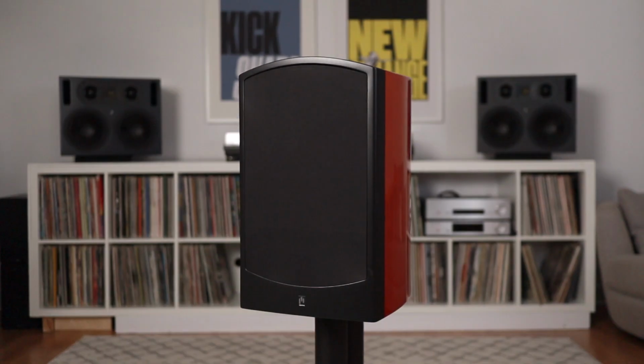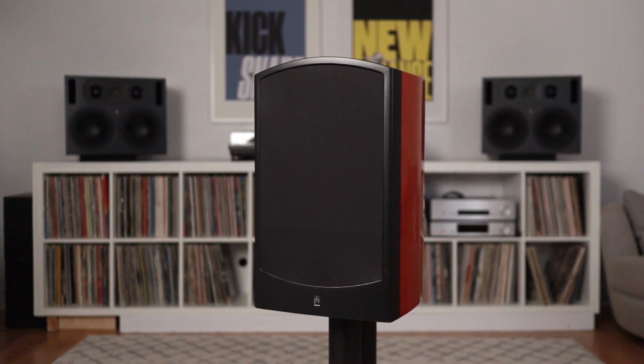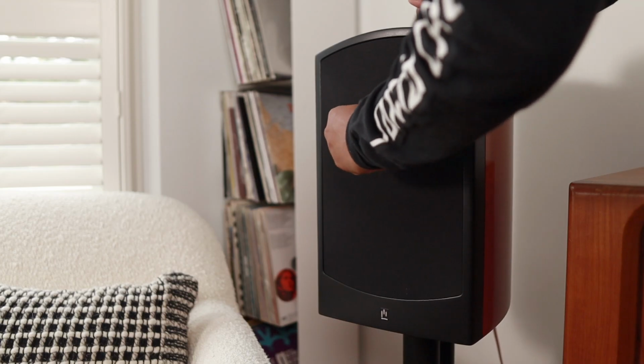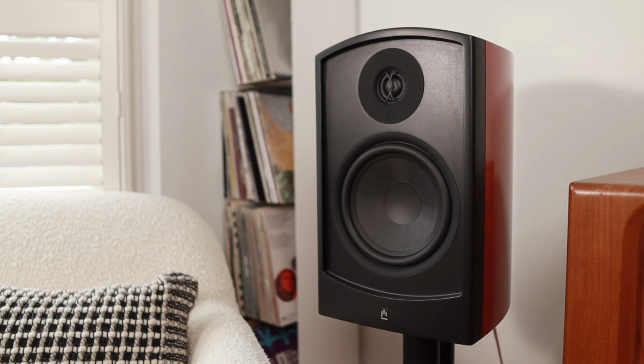Yuck. All of these speakers are finished in a beautiful cherry gloss, and all of these speakers have magnetic grills. The magnetic grills are inset into the speaker's front baffle, and it gives a really nice, streamlined, and minimal appearance. Though, I found, especially when I was playing the Concert bookshelf speakers in a hi-fi setup, that at louder volumes there is an audible vibration noise. So you do best to remove the grills for anything other than low-level casual listening, just to mitigate any vibrations.